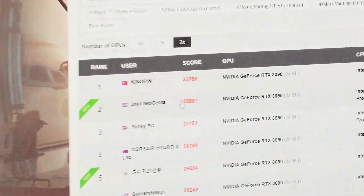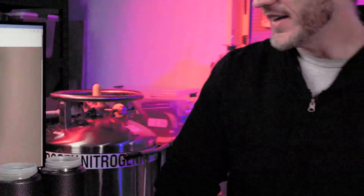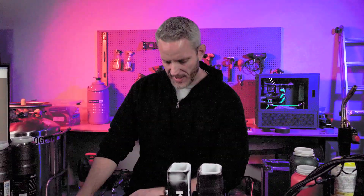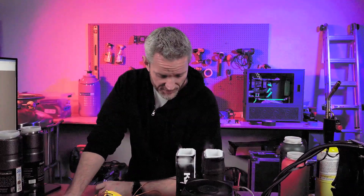Did you know that you could actually take a score, send it to someone, let them upload it, and it'll be under their name? There it is — 32,087. So yeah, we're almost 2,000 points behind Kingpin, but that's fine. We have more in it. I know for a fact I can get 33,000 with these cards with a little bit of tuning. The hardest part, honestly, is consistently pouring without getting all over the motherboard. Almost a 2,000-point increase today by not even that much more core clock. We were at 2,190 average megahertz before, and if we look at this run, we were at 2,400 average megahertz. Memory was slow, although my memory was about the same speed as Vince's — he was only running 1,500 MHz just like we were.